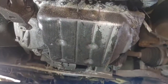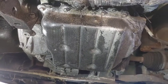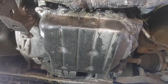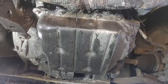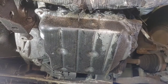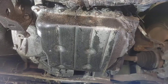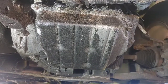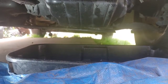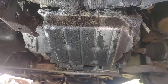I already got the lights set up and there's your transmission pan right there. Along the edges of the transmission pan are the 10 millimeter bolts you're going to have to take out to drop the pan. There is no way to drain the fluid out, so you are just going to have to try to not make a mess and place your drip pan below the transmission pan to catch as much as possible.